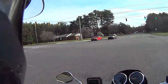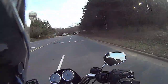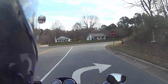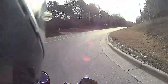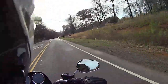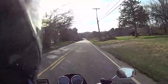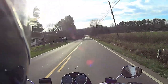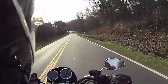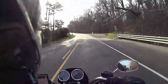For full disclosure, this is not the first time I've ridden this bike — it's probably the third or fourth. Hammer's break-in procedure is: start it up, let it idle for about 10 to 40 seconds, do a one-mile ride, then a two-mile ride, then a 50-mile ride under 3,500 RPM. I've already done that 50-mile run, and now I need to do another 450 miles under 4,000 RPM.